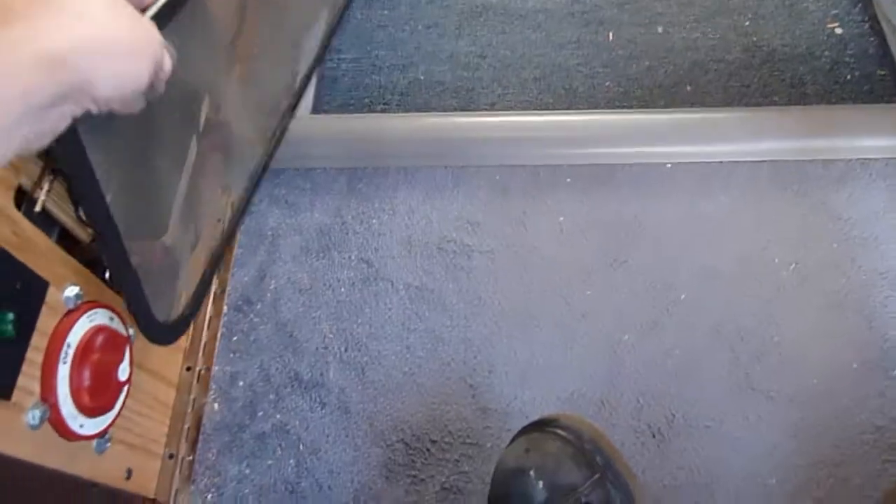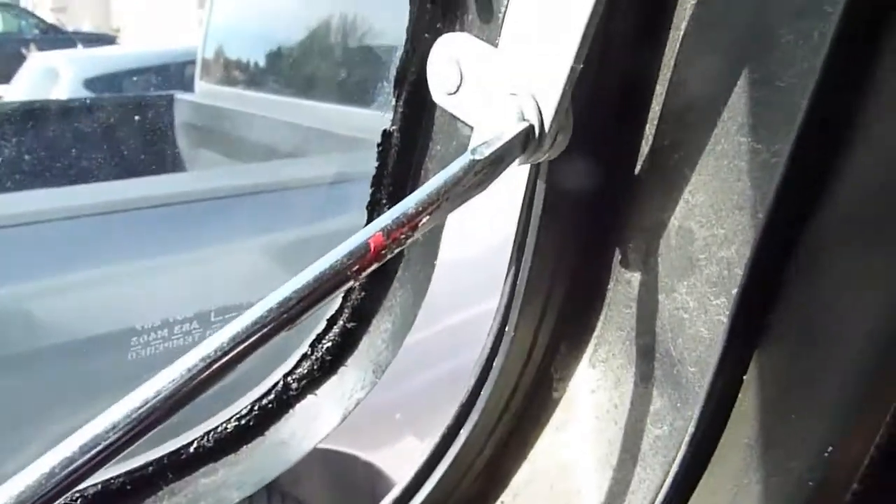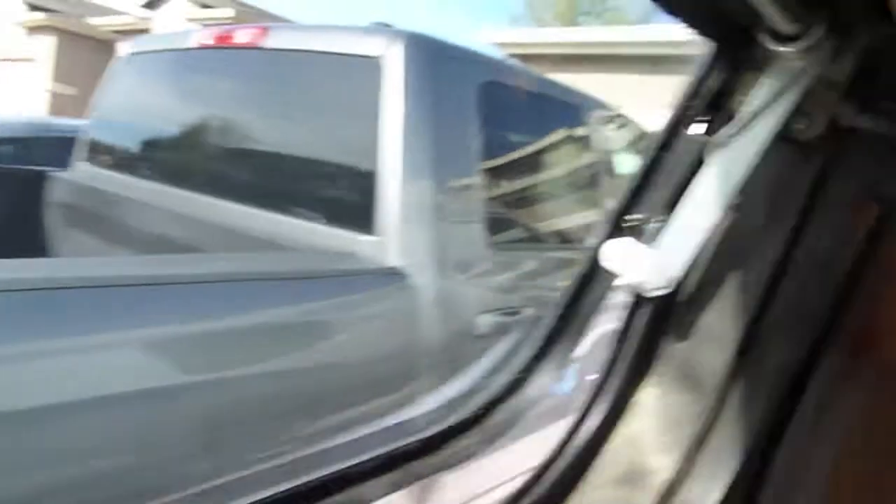So first, remove the screen — I need to pull the screen on this side anyway. I'm replacing both sides, by the way. It took two weeks from eBay to get these parts — they're only coming from Florida, people. Shouldn't take two weeks. You see these little cotter pins? You just use a screwdriver, stick it right in the notch, and pull it right out — there's one on each side. Once you do that, you push those little pins out outward and the window is free to move up and down, no longer attached to the bars. Then lift the window up and it pops right out.